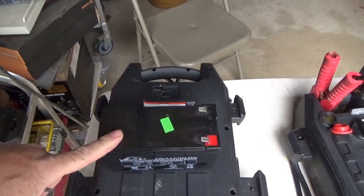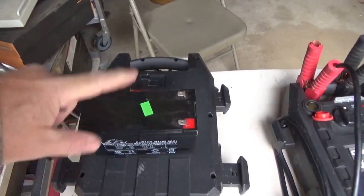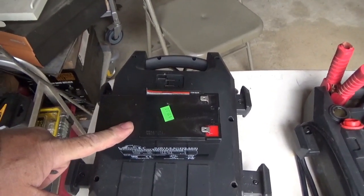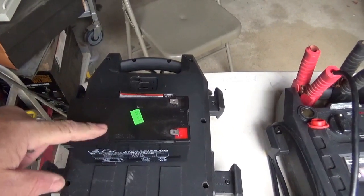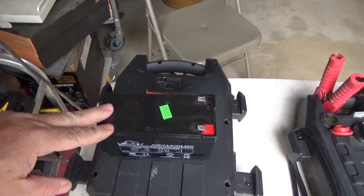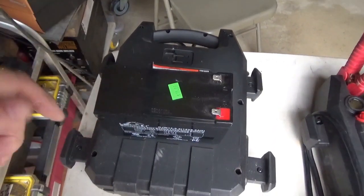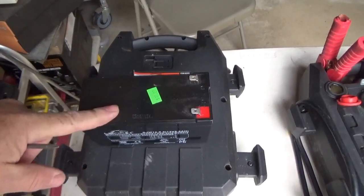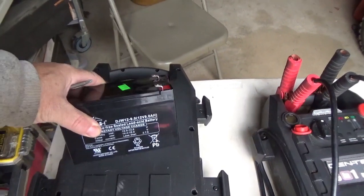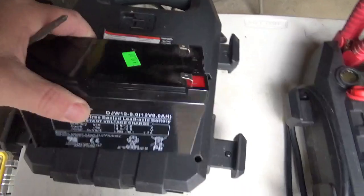Whatever information they were holding is important, so every year when they service the power supplies, they swap the batteries out. UPS batteries don't last a real long time because the cases run hot with poor ventilation, and eventually the electrolyte degrades and they fail. Luckily, these batteries seem to hold charge — I bought them a while ago, put a charge on them, came back and they still held it. So we're going to swap one in.